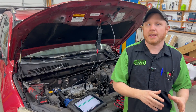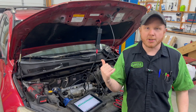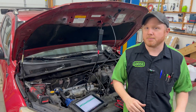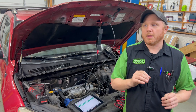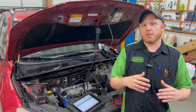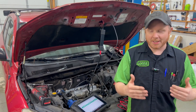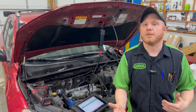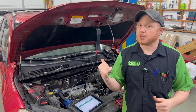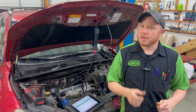We're assuming that basically the only symptom this car has is a misfire. So one thing that's a good idea is to kind of get engine mechanical out of the way — and what I mean by engine mechanical is compression. If you're working on a car that's worth $2,000 and it's going to need $2,000 worth of head work, that might be as far as you need to go and the customer might just sell it or trade it in. So an easy way to do that is called a relative compression test. If it's only missing on one cylinder, we know the rest have enough compression not to be misfiring. We can check compression relative to the others using stuff that's already on the car — the starter, the battery, and an inductive amp clamp.